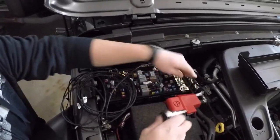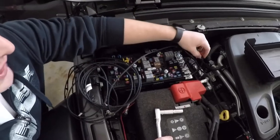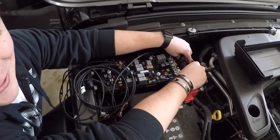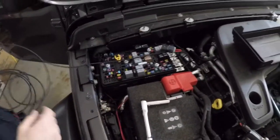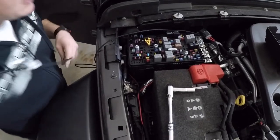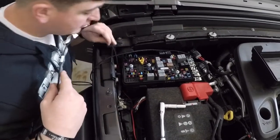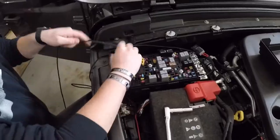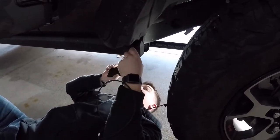We're going to tighten this bolt up. We can put two zip ties around this main wiring harness — they have to be 100mm apart or your entire install is messed up. Once we do that we're going to take the rest of this wire, untangle it, and feed it down into the engine compartment. That way we can access it from the bottom of the Jeep to get the wiring harness to go through the firewall. Once we have this, we're going to pull all the slack down — this wire has to run the entire body of the Jeep.